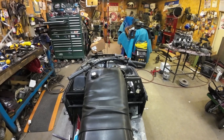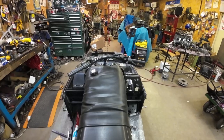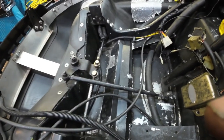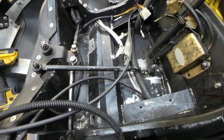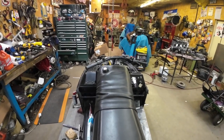Here is how far the handlebars are off after the alignment procedure. I've still got the rod through the spindle, so I know straight ahead. I'm just going to adjust this link until I get the bars back to straight ahead. But here's an issue — that tie rod has run all the way up as short as it goes and it still needs to get shorter. Damn it. I guess I'll pull it off and run over to the bandsaw quick and take about a quarter inch off each end, re-tap if I need to. It'll be fine.